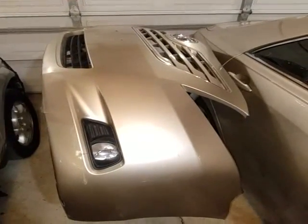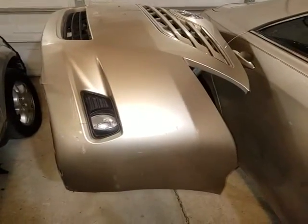So I'm actually on the driver's side and you want to pull the splash shield back. There's another 10 millimeter screw there that you want to take out, and this will release the other part of the bumper. Okay so here's the bumper cover removed — I actually have it on my work stand so it's not on the ground.